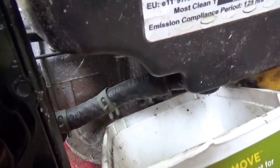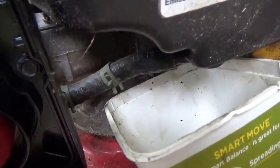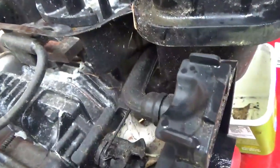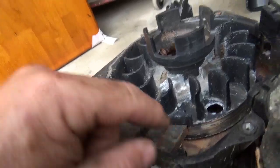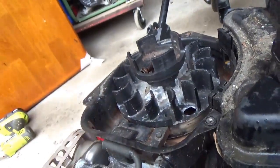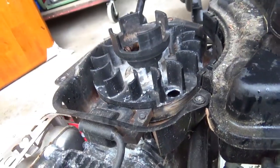I'm going to ease the gas line away and catch the gas so we can take a look at it and see how ugly it is. I'll clean up this container a little bit first so we can see what it looks like. This carburetor slides on, and you can see we're building a little something in there for mice. It wouldn't be surprising if they got in here — there's plenty of space, and they can cause your engine to overheat. Easy enough to clean out; there are only three eight-millimeter bolts to take out.